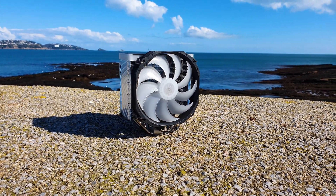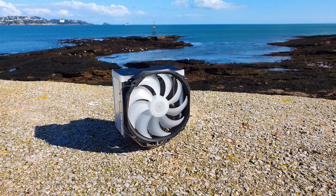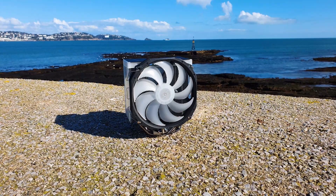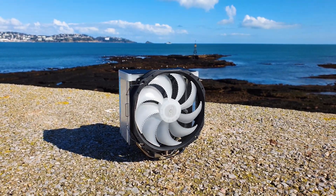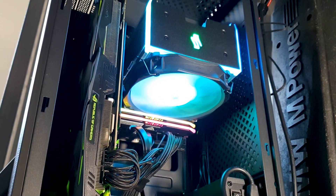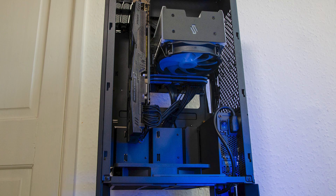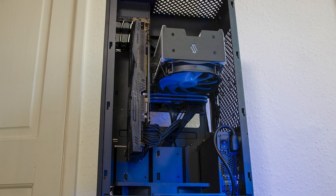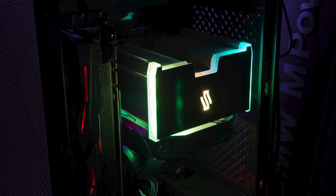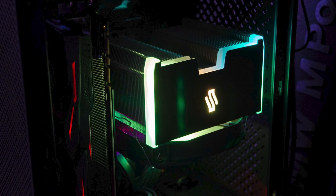Well there you have it guys — once again Silentium PC delivers an impressive air cooler product with great value for money. The key selling point is the remarkable low noise output even at higher RPM points. Cooling-wise, it had no trouble taming an overclocked 4.7GHz Ryzen 5 5600X at 1.275V. The ARGB eye candy is implemented in a unique way, and I really like its 159mm tall footprint because you can install it in so many cases, even a micro-ATX case. The Fortis 5 is fully ITX-friendly with zero clearance issues in any direction on at least AM4 boards. Kinda hard to fault it really, besides its low availability outside of Europe. Thank you for watching guys, see you in the next one — Alex out.